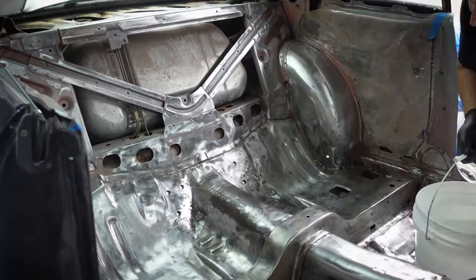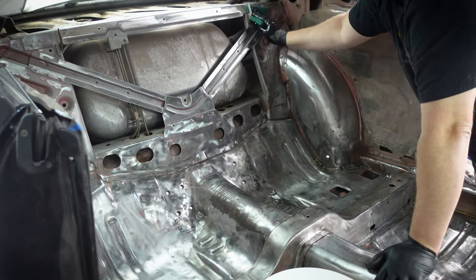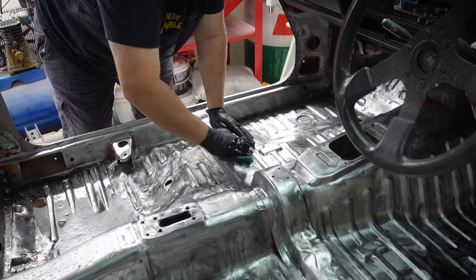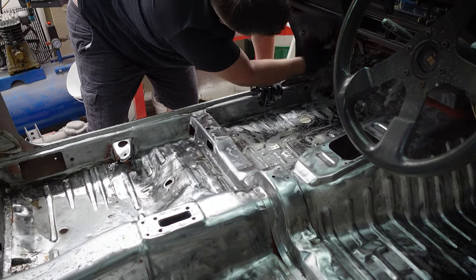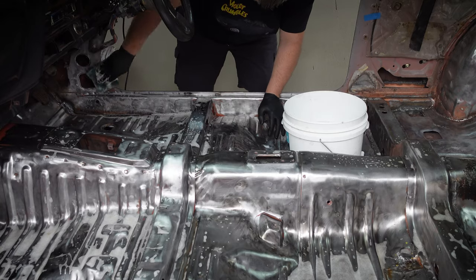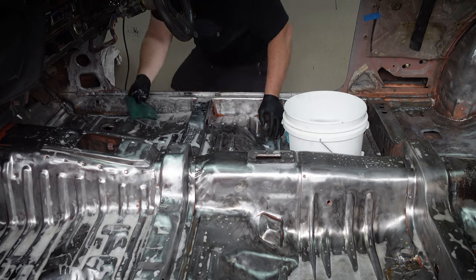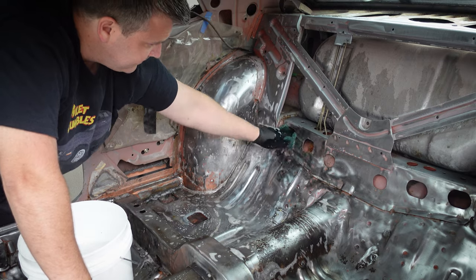Okay, so first up with the degreaser, I'm using 50 degree water and I'm also using a Scotch-Brite pad because I figured if I'm gonna be cleaning the top layer, I might as well key anything that I've missed with the wire wheels and the stripper discs. This didn't feel like a particularly special degreaser when I was using it, but I did notice that after I was done, there was none of that kerosene-like residue that you can get with some other non-water-based degreasers.